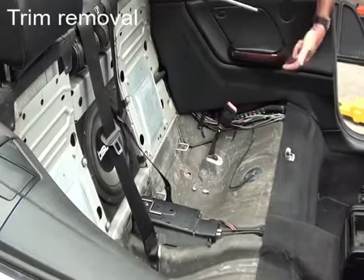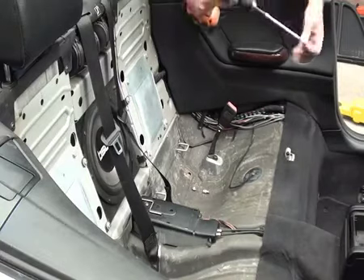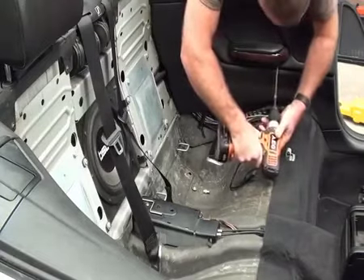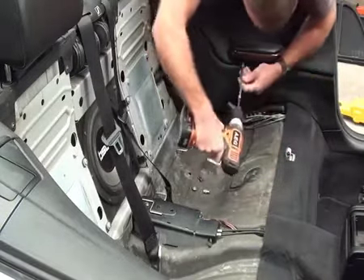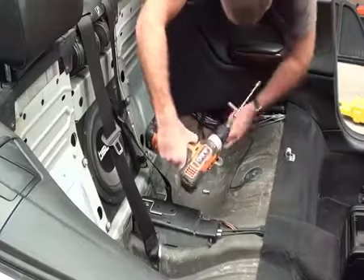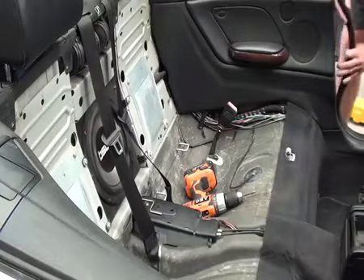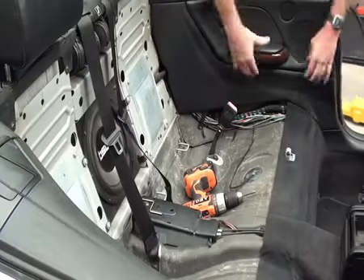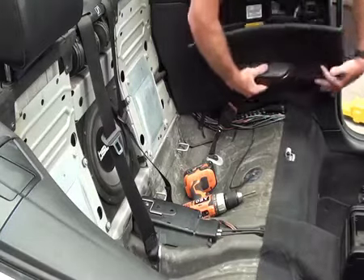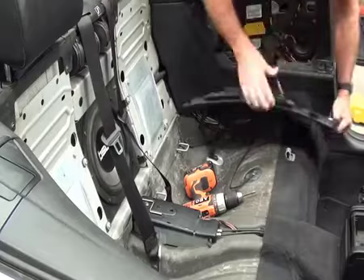To remove this panel here, there are two 8mm screws that are on the other sides of the armrest. You're just going to remove those. And once they're out, I'm also going to pull that seal clear and pull it straight out. Then what I'm going to do is just gently pry that — there's a couple of clips underneath it. Pull that clear and then disconnect the speaker connection, and then that piece comes out.